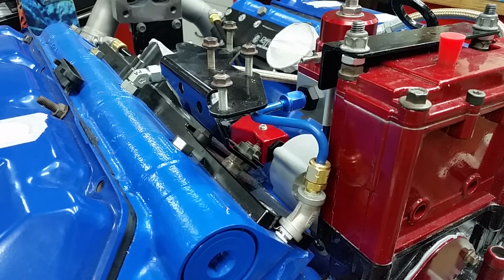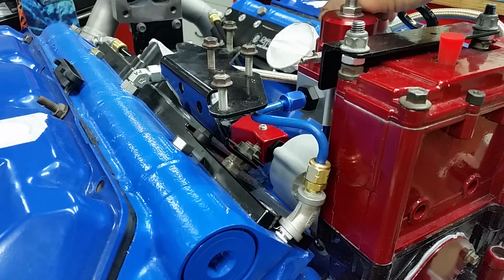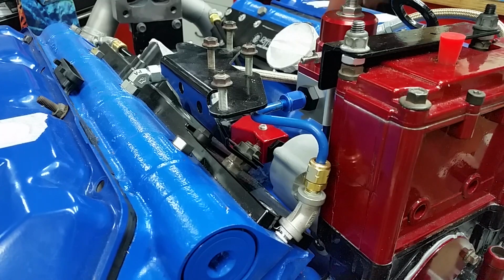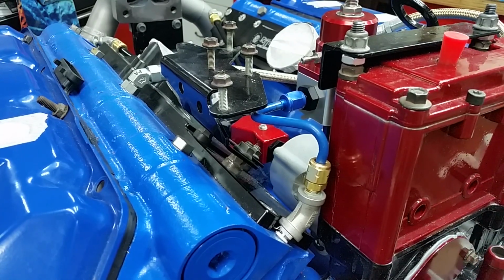And of course then, we're going to clean the bench off and get the wiring harness out, clean it, check every wire in it, make sure continuity is good, what it's supposed to be and all that good stuff. Eliminate the ones that we're not going to have sensors for, like this exhaust back pressure. We're not going to have that sensor. There's a tag for that, and there's the pedestal diverter. We don't have that because we don't have that type of turbo anymore. There's a couple of them, and we'll get those ready, and then we can do that after the engine's in. Put the harness in, because there's no connections in the back of the engine. They're all up front, which makes it nice.